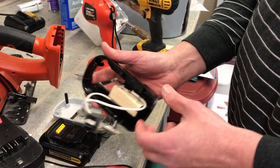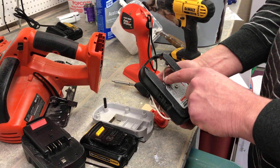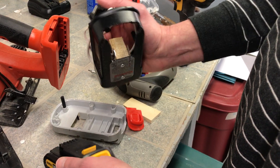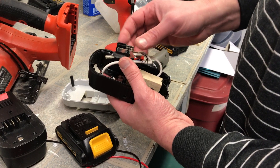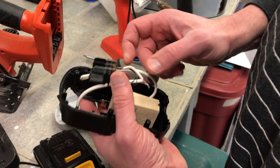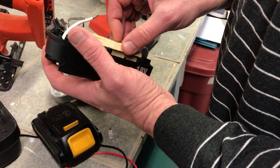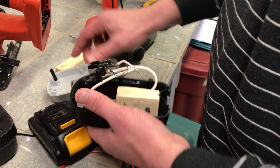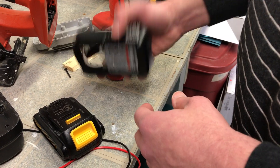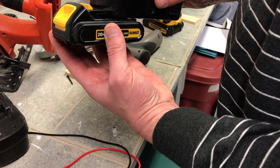As you can see I took out all the battery cells and threw them away. I rigged up a system where I have two contacts that correspond to the 20 volt contacts in the DeWalt, soldered to a wire hooked up to the existing connections. I used heavy gauge wire, put it back together, and used wood as an insulator to keep the contacts separated. The hardest work was just routing it out, and I used cardboard to make sure the connections were good.